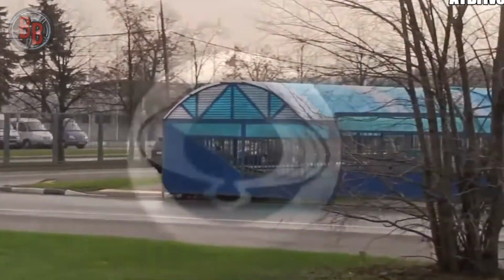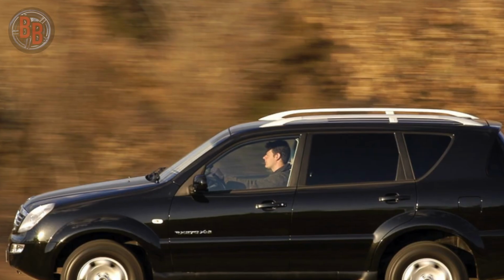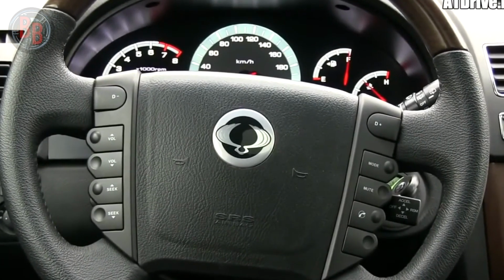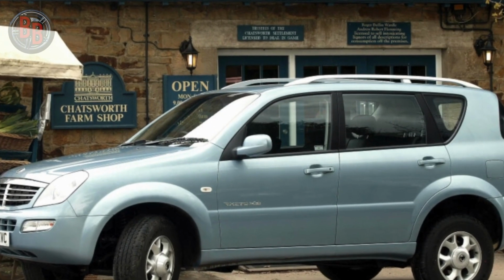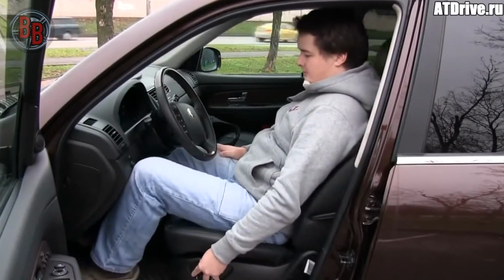With a loss of traction and the engine malfunction indicator lights up, the turbine is often sentenced. In fact, it turns out that one of the leaky pipes of the air supply system is to blame. Therefore, the diagnosis of the boost system should be carried out using a vacuum gauge. Gasoline units with timely maintenance do not cause trouble.